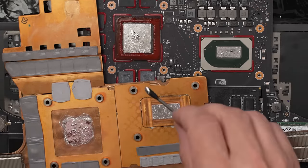Let's get the heat sinks back installed. Hopefully this is gonna solve our cooling issue. Next, fans, battery connector, back cover, or bottom case. Then we can start it up and see if what we did was any good. But now that I think about it, I wanna make sure that that conformal coating is totally dry. So I'm gonna set this aside and let's take a look at this LG laptop. And here we go, let's see what this one does. Starts up so far. Okay, it does show a picture on the screen.